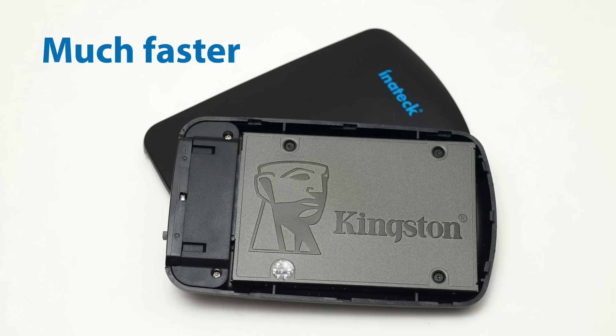Next, you need to flash the Pi OS to your external USB drive the same way that you do to a microSD card. Not all USB flash drives or external hard drives work, but most SSDs that I tested do. One thing to keep in mind: most USB flash or thumb drives won't give you better performance than a good microSD card. For best results, use an external SSD like I'm using. There's a link to the exact model that I used in the description below.